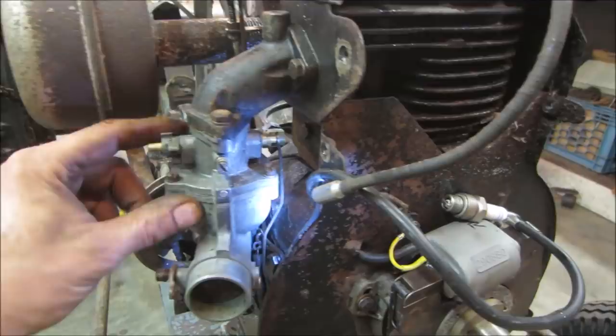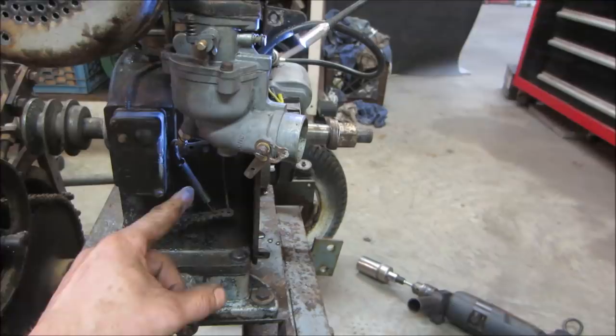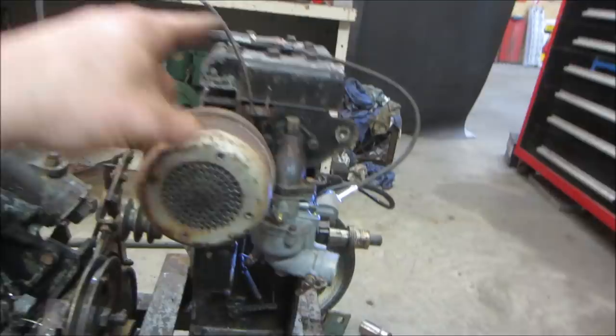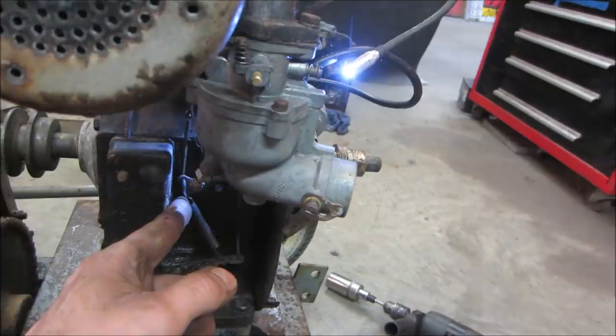It's got a governor inside that as it revs up, it takes throttle away. You can influence that by how much cable you pull on the spring that's over here, and that's the throttle cable that goes up. So you're essentially forcing more throttle on it, and then as it gets up to its RPM, it'll back off a little bit. So this is 2800 RPMs with the cable pulled all the way up, and then you let it relax